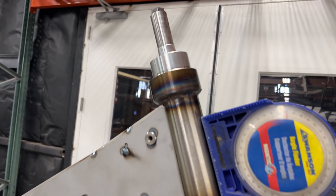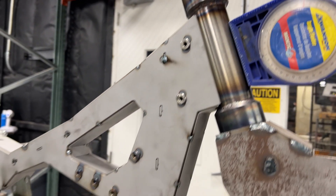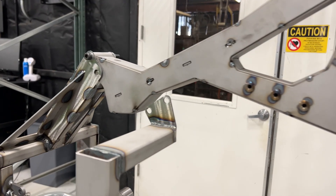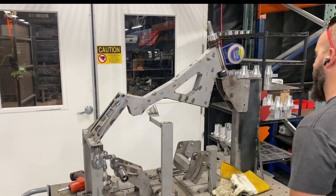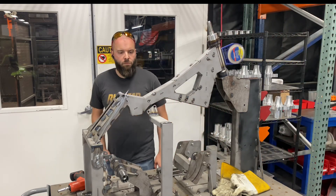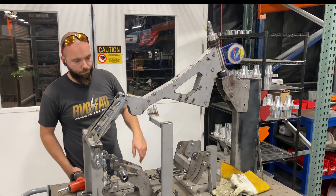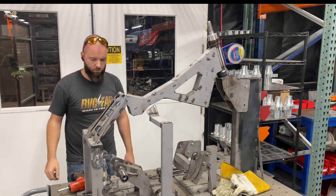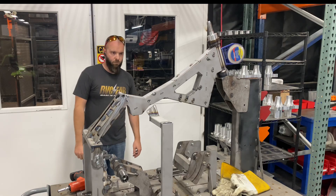Here's a shot of the head tube. We ended up taking 5 degrees out of this YZ250 frame. I think it's going to be perfect for the trike. We can still do a lot of tweaks on the rear shock and linkage, but more or less we just wanted to steepen up the head tube. The goal is to run longer forks and not have to shorten them up or play with any of that geometry. We're going for extra ground clearance underneath the engine.